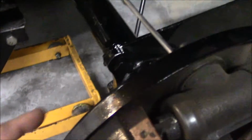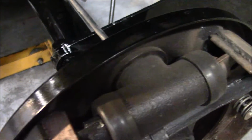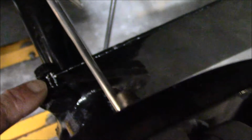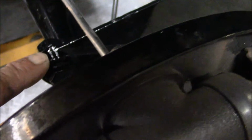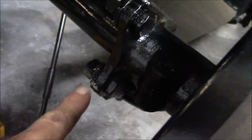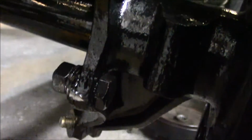I didn't touch the rear 2 bolts. They're still tight, because before you loosen them, you have to check your alignment marks. There's a mark on the top, right there. I have it highlighted in white crayon. And also when I lined it, I put one in the rear. I think you can see that.